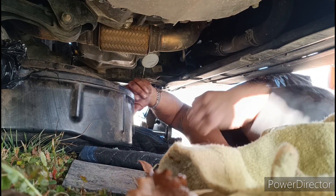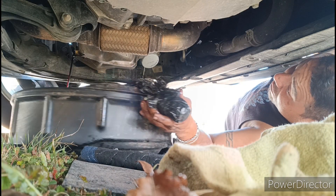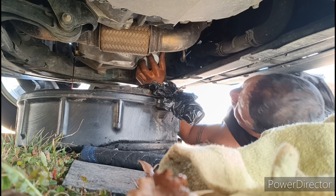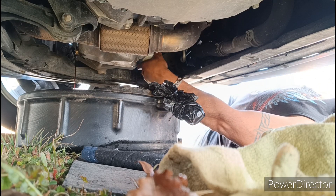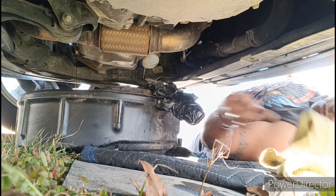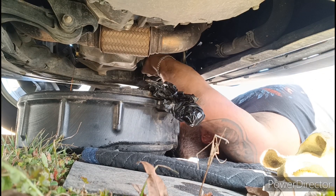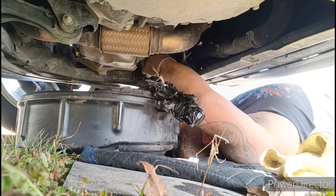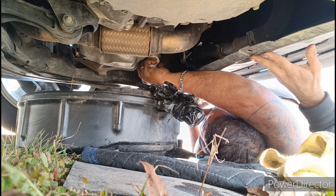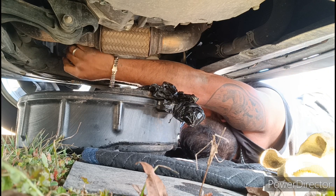You see how it's draining now — perfect. The oil was starting to get a little dark and dirty. Now these filters, they don't get tightened with all your strength, because it's a special little thread. If you tighten it too much you're gonna mess it up, so normally it's just by hand. It's got a thick rubber gasket so you almost have to squeegee it in.